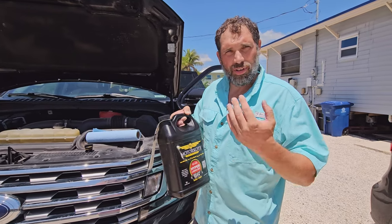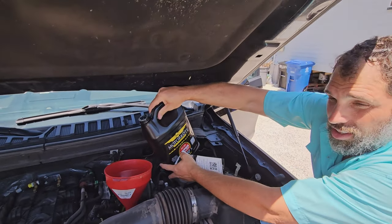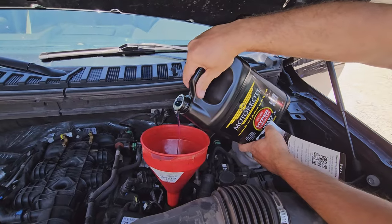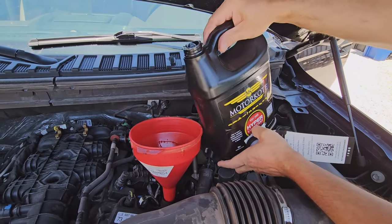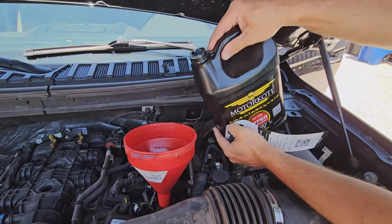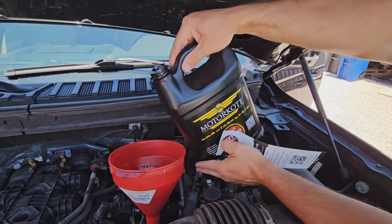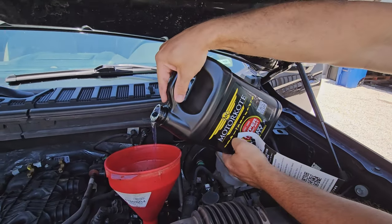I'm putting it in the lower unit, I'm putting it in the motors, I'm putting it in everything. You can see as I'm dumping it into my vehicle here — I've got to put 14 ounces total, two ounces per quart. You can see the stuff is super clear and really thin. Still got a little more to add; I'm measuring it off the container. Two ounces per quart — this thing takes seven quarts.